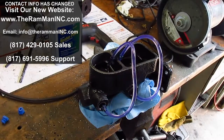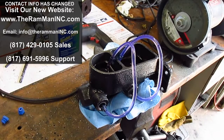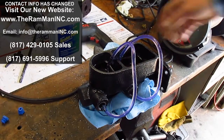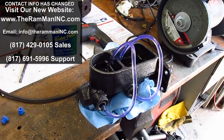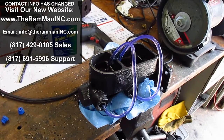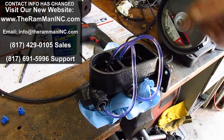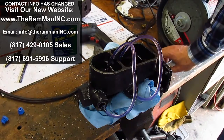This is a typical snout master cylinder used on B&E bodies between 1971 and 1974. This is a client of mine who had some problems getting fluid out — he's running DOT 5 synthetic and was complaining about poor fluid flow. We've got it set up with our tubes and DOT 5 poured into the two reservoirs, and I've pumped out the air, so we're going to check the fluid flow.